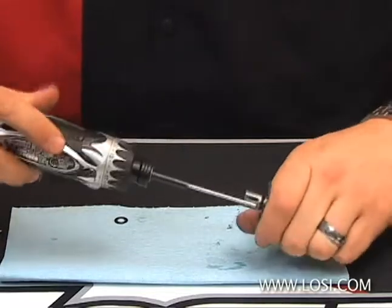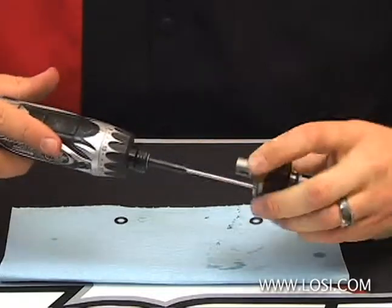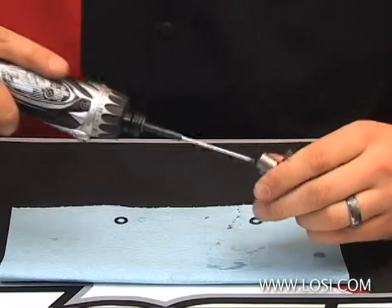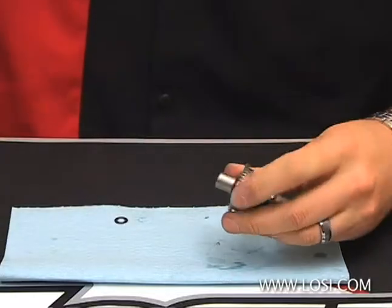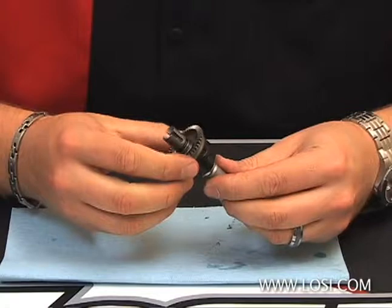Once you go to put the 4 screw in, you can go ahead and crank it down. Snug it a little bit extra. Then make sure you tighten the other 3 screws. Check the diff just to make sure it's got free diff action. And you're ready to go.